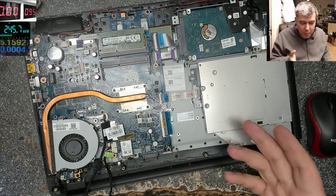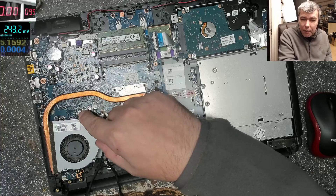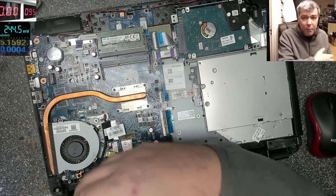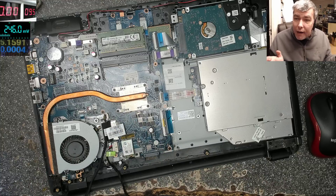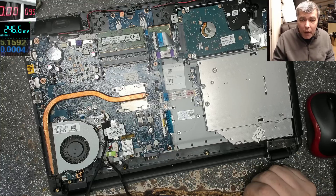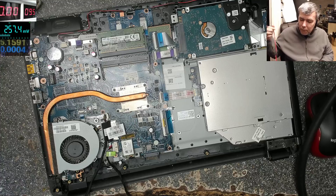What could go wrong? I checked the RAM power supply — no short. I checked the 5V rail with my power supply — no short. I removed the ribbon cable from the power button because the hall sensor is on it, then bridged it to ground to try to start the laptop — it didn't start. I spent one hour on this, examining the motherboard. We have no schematics.